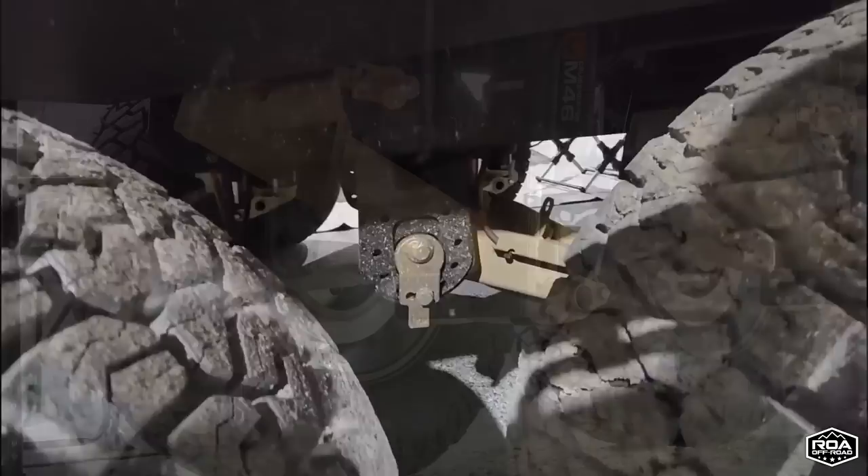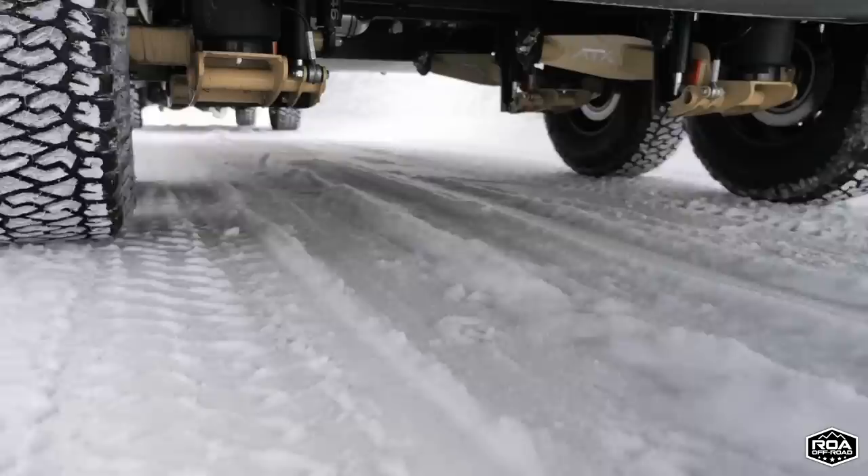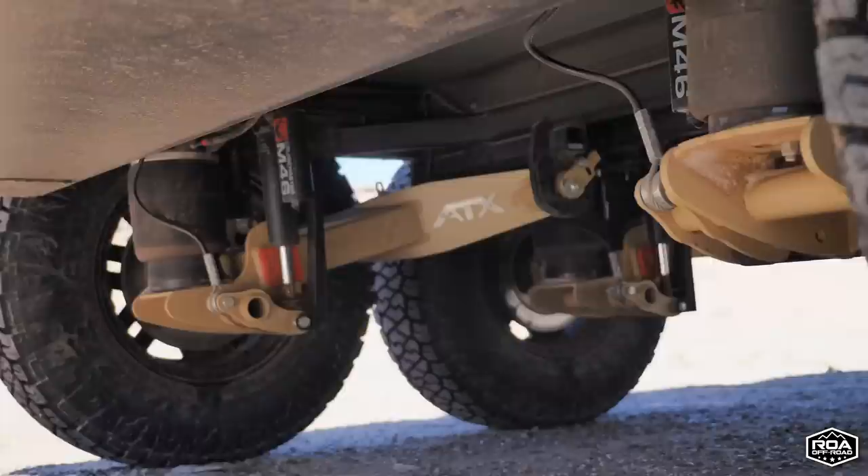This is the ATX — the most heavy-duty Cruise Master suspension you can buy on the market. It's a company that comes from Australia. It's independent air coil with reservoirs, and it's electric-over-hydraulic disc brakes, so brakes are super grippy and strong. It's running a Maxxis Razor tire — load range E, all-terrain. This is a common tire you'll see on Baja trucks.